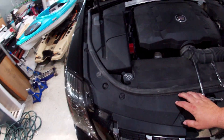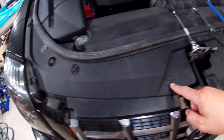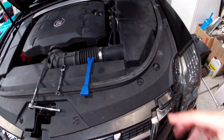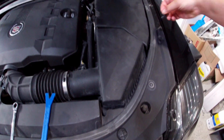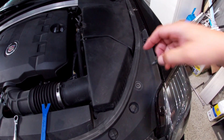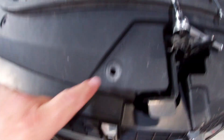It's not hard, not a difficult job, and we'll get in and get this done. To start, we got to remove this cover here — really simple. There are some little clips here, here, and here that we're going to pull off to begin. These things you just kind of twist and then you lift the clip out. Once you get them loose, they're just going to pop out like that — a little expansion clip. When it screws down it expands and holds it in place, so we're just going to pull all these out really quick.